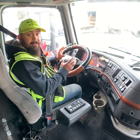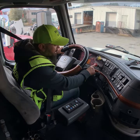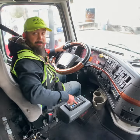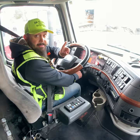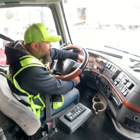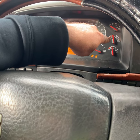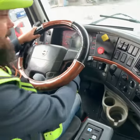When we say that, after that, B: tractor protection valve pop out, trailer protection valve pop out, or apply, and check neutral. When everything is perfect, start the engine. But before you start the engine, you have to do a last review of air pressure, because maybe you forgot to check it. If it's less than 90 psi, it's okay. If it's more than 90 psi, you have to pump your service brake. But we did that before. Start the engine.